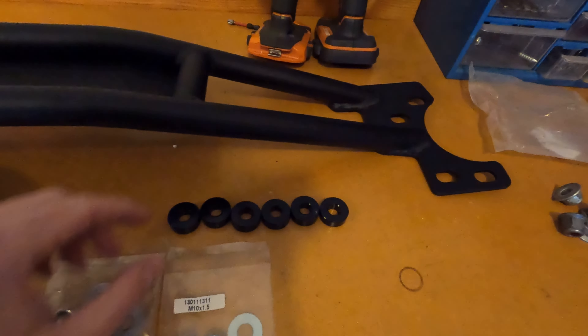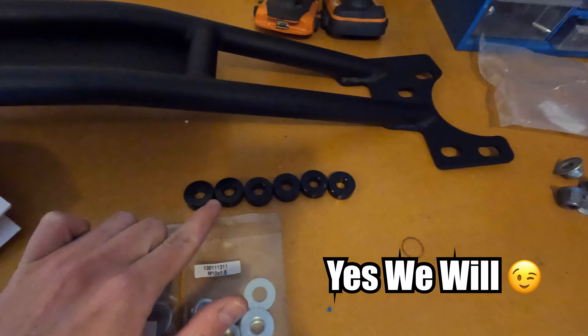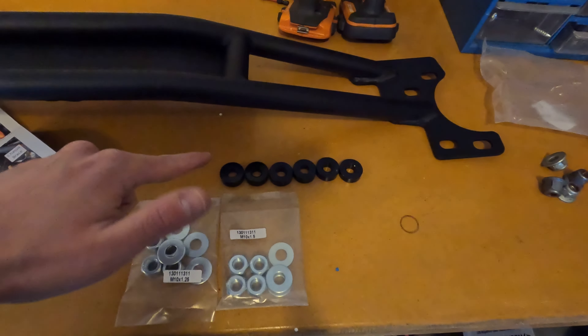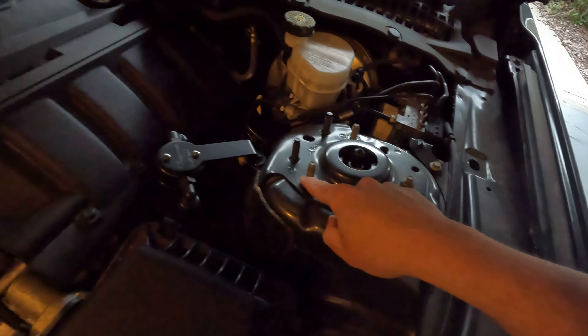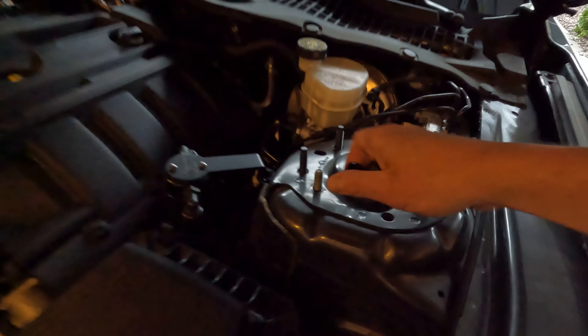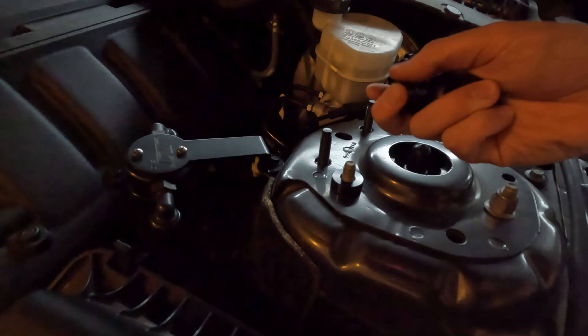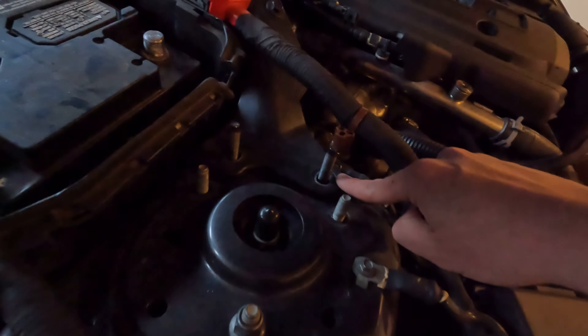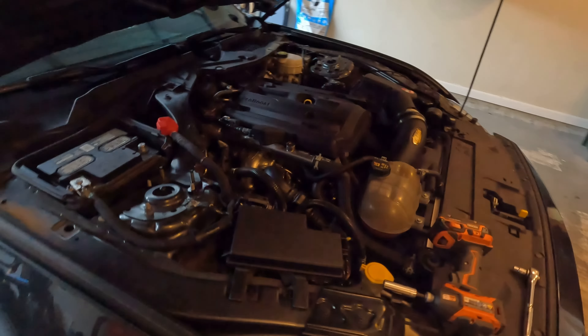Now I want to show you one more thing — what's included here are some spacers. We might not use all of them, but these spacers are going to go on to the studs that we didn't have the chassis brace connected to. Because we don't have the chassis brace over here, if we put on the brace just as it sits it's not going to sit level. So we're going to use all six spacers included with this strut tower brace, putting them on all four studs for a nice even mounting surface. I've got two left so let's go over to the passenger side and put them on those two studs so it's a nice even and level mounting position.